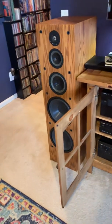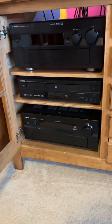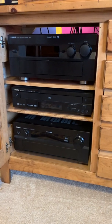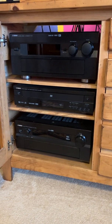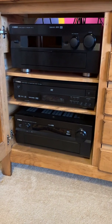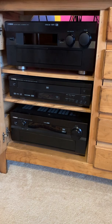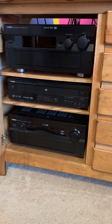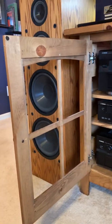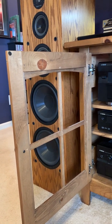I do want to get more out of these larger speakers and the RxV3300 that I had just isn't quite enough power to drive all of them, especially in full range. What I had mentioned before is I was using my subwoofer to its full potential by just sending the 90hz frequencies to that and letting the RxV3300 power the frequencies above 90hz. But I'd rather have a little more use out of those two 10-inch woofers on my 3009s.